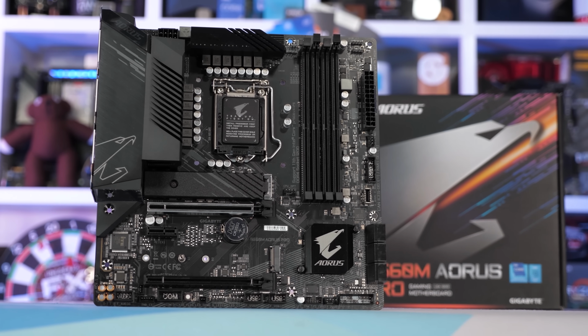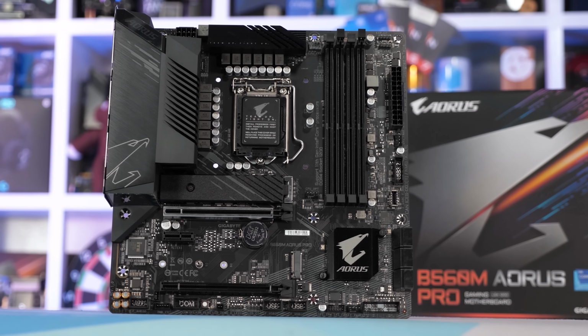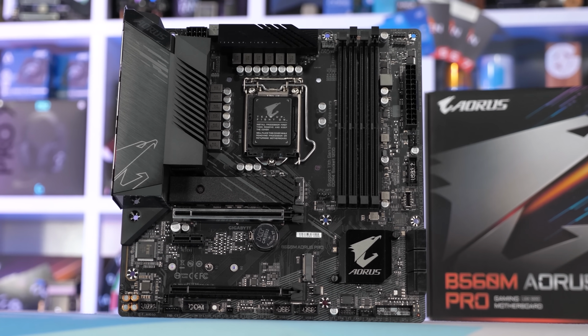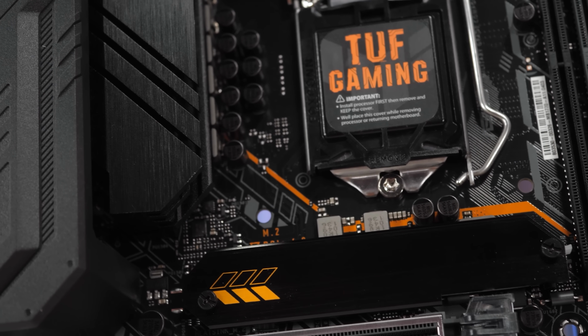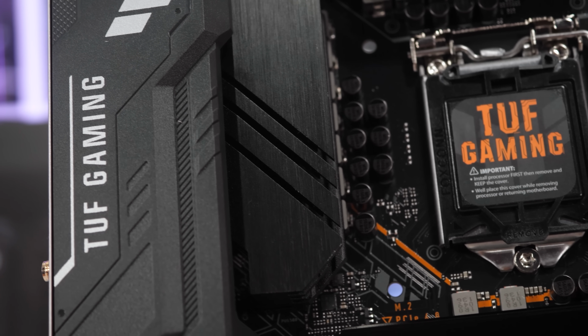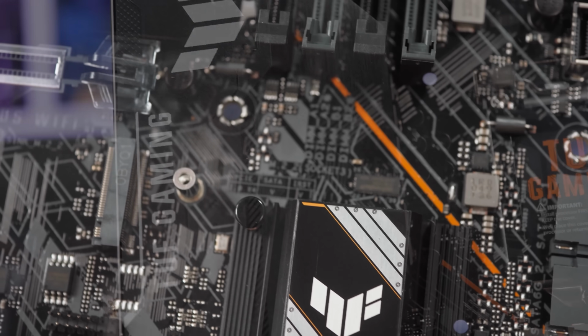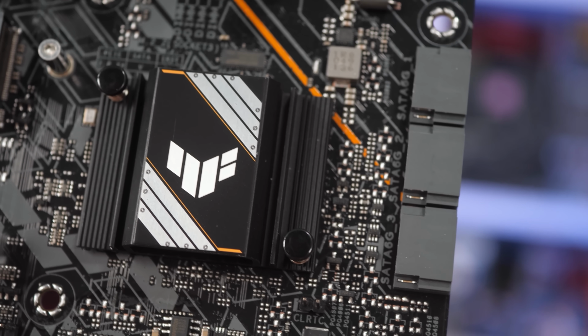For all of this testing, I have changed up our normal configuration a bit. All 4 configurations using the B550, X570, B560 and Z590 motherboards all use the same power supply, memory, cooling and graphics card. Because these budget boards only feature 2 DIMM slots, I've only used 2 memory modules, and therefore we have 16GB of DDR4-3200 CL14 dual channel single rank memory.